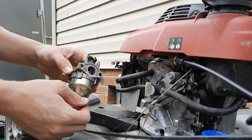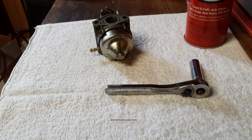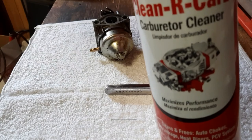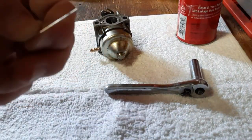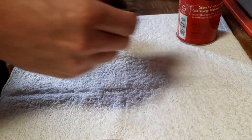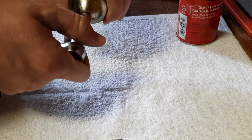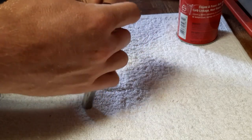Okay, now we're in the shop with the carburetor. There are two more things you probably need other than your 10 millimeter socket wrench: you probably need some carburetor cleaner, and for cleaning out the carburetor what I have is just a small needle. I'm taking the bowl off now - normally I don't know the exact sizes for this but a 10 millimeter socket wrench fits this just like the previous bolts.